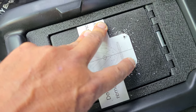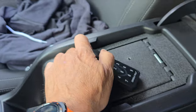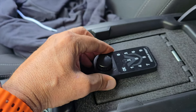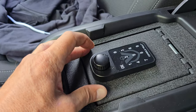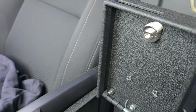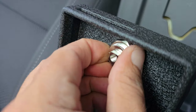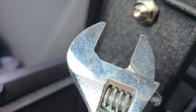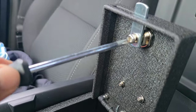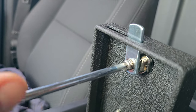From there, I'm going to begin making a couple of holes following the template. Once I have those two holes, I'm going to match up my electronic lock with the opening that was already existing in my ConsoleVault. From there, I'm going to add the spring washer and the collar nut. Then I'm going to use the screws and the washer and put the screws into the holes I made with my drill. From there, I'm going to insert the latch and screw that in also with another screw. And from there, my installation is done.